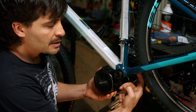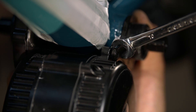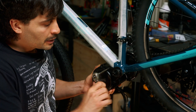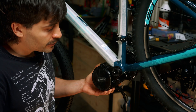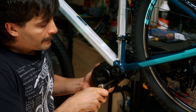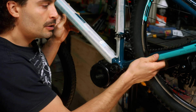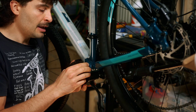We know we have enough clearance between the motor shoulder and the chain stay. Now I'm going to set this metal plate onto the frame. I'll first tighten these bolts — you can see my torque range is 10 Newton meters. I heard the click, that's it — I don't need more torque than this.